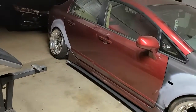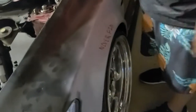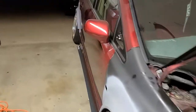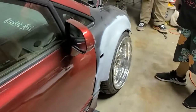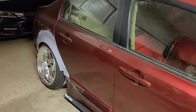The rear went back to normal. You need to take that camber out — this one's toed in or toed out a little bit because it stands straight up. It's toed out. This lip is sticking out a little bit more than this side. Oh yeah, I see — toed out, we gotta bring that in. It's all just a small adjustment, or his flares are off — a little bit of both. Take it to an alignment shop, it's good enough. You can adjust it by hand too. And with the rear, we can just add washers on later.